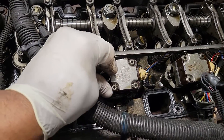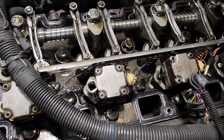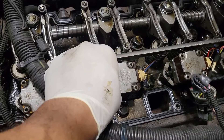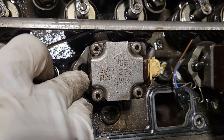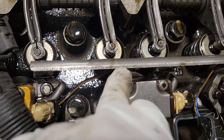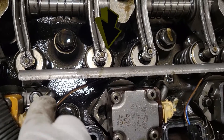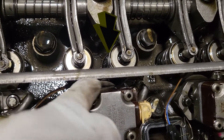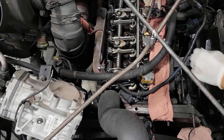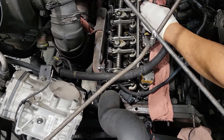Next, I'm going to use an 8mm to remove the bolt from the injector. After removing the injector bolt, we're still going to need the 8mm socket to remove the wire harness rail. We're going to have to remove it from each injector so we can move the rail out of the way and actually get the prior clamp up off the injector. We have six bolts to remove for the wiring harness.